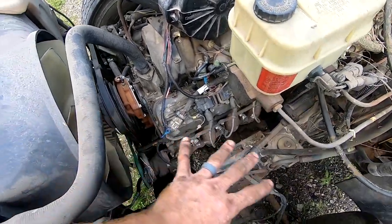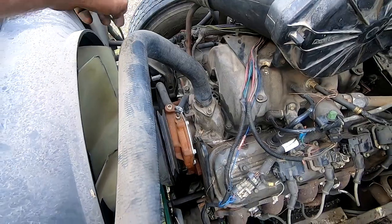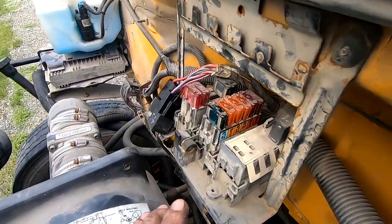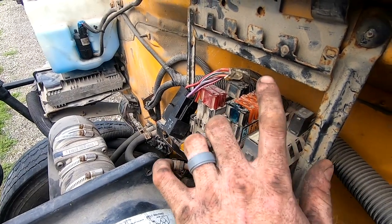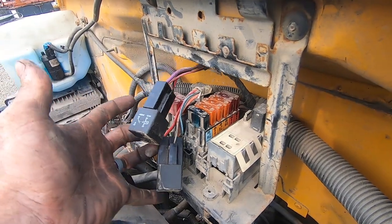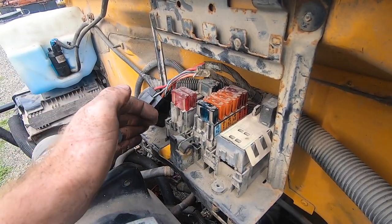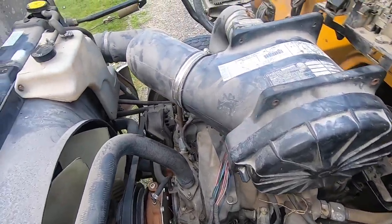And so I've kind of gone through, I've seen some fixes like that. There's a couple over there. Couple of these fuses, this 60 here and this 40 here, were swapped for some reason. Don't know why. You know, somebody's been in here. These are newer looking relays. I took the cover off of that, and I'm not sure what's up.